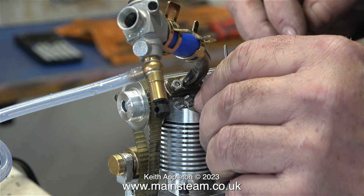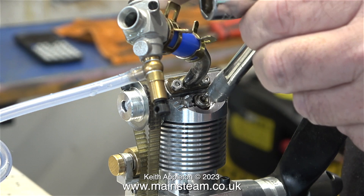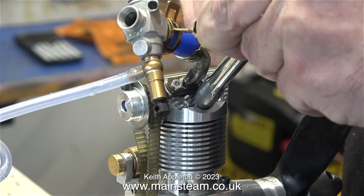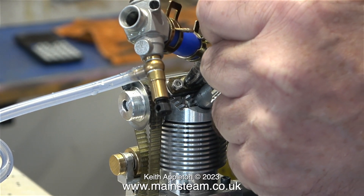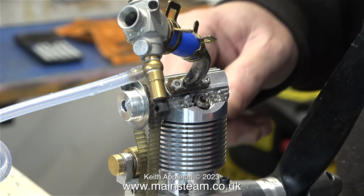Four-strokes are notorious — as you fire them they'll backfire, go pop, and then suddenly they're running in reverse. And they'll run in reverse and throttle up in reverse. So that's what we've got with this.